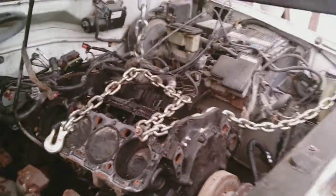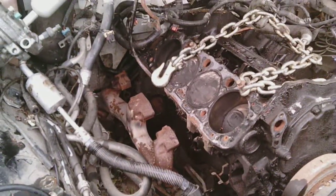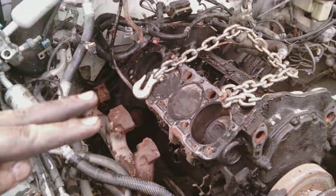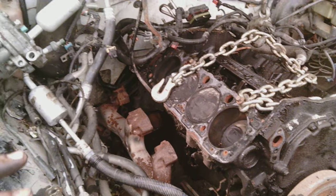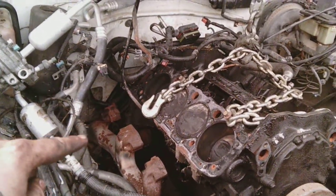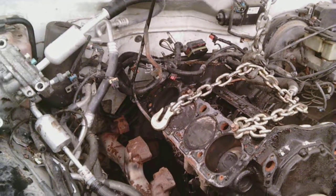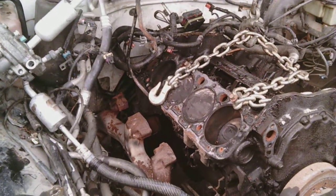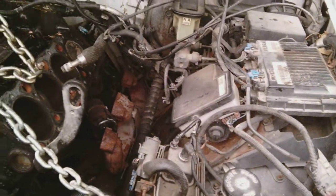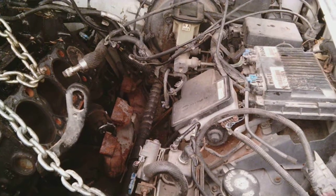I had an issue with the exhaust manifold, the bolts that attach to the head, the bolts that go this way. Those are 9/16 heads, and they're easy to remove, but the bolts on the back side, there's three of them, and they're 15 millimeter. I got all three of those, and all three of the ones on the other side turned about maybe a half turn, and then it got so tight on the rust that I thought it would break if I turned any more, so